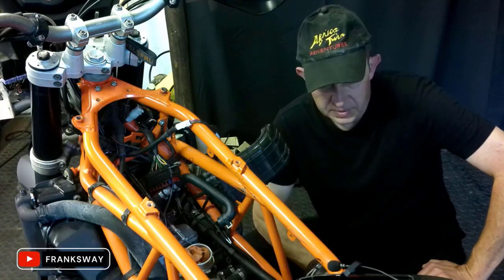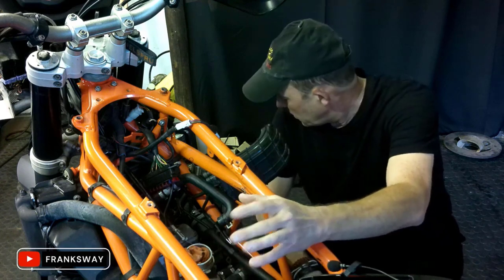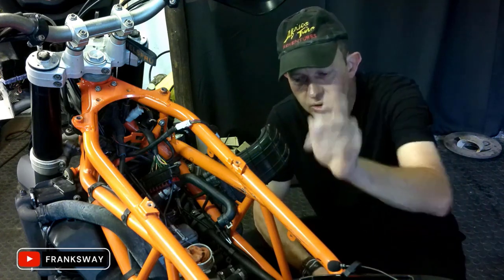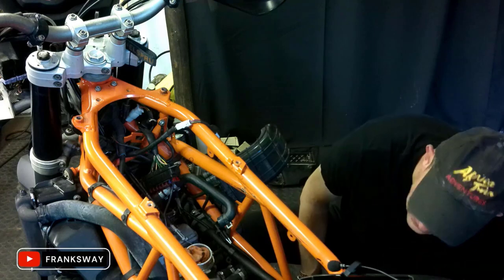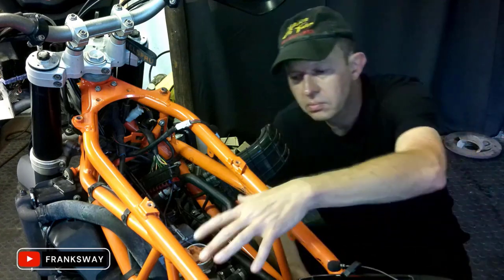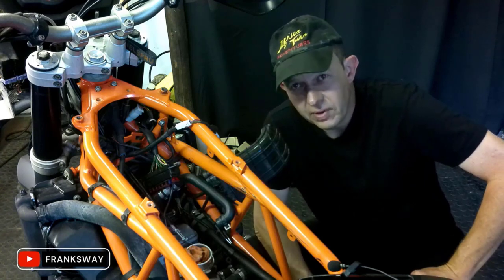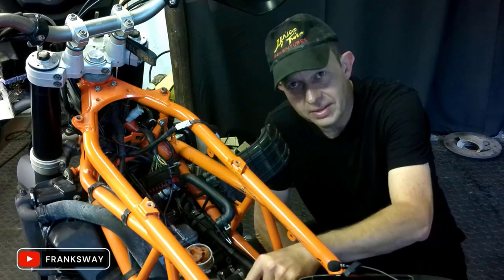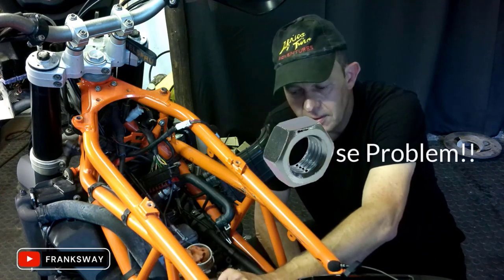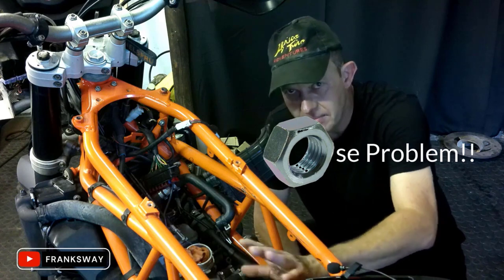Right everybody, it's time we start reassembling the intake system. We'll do the throttle bodies. I have changed the oil switch. Very important, one of the first things, if you ever get to a point where you disassemble the intake system, the very first thing that you do, take rags, plug the intake holes, don't forget about it. If something falls in here, it's a mission to get it out. So guys, please, rags immediately.